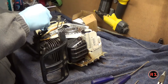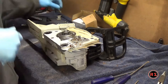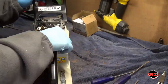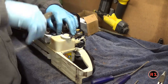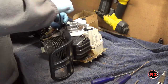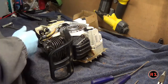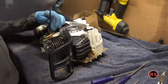I felt it would hold the neck of the carburetor more firmly if I started by screwing the higher bolt on top. I decided to fast forward this part because it's pretty straightforward — it's the reverse of how you removed everything. And here again, before closing anything, make sure you don't forget to connect the wire to the coil, because your saw will just not work at all.